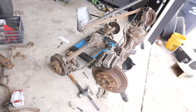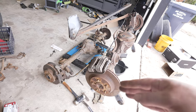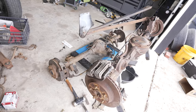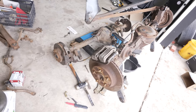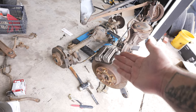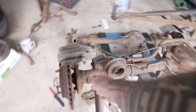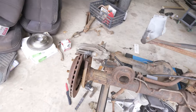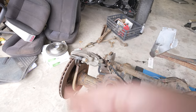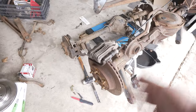You can also get the fourth gen rear axles, but your axle is going to sit out like an inch and a half on each side, which I don't like the look of. Apparently the parts are also super easy to find for those — the LT1 rear ends — but the parts for this nine bolt are also decently easy to find; at least the rotors were, and I assume the calipers would be too. So if you find one of these rear disc setups cheap, you can spend $110, get these backing plates from FlyinBye.com, get calipers and rotors, put those on, and you've got this rear end.